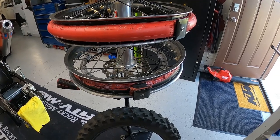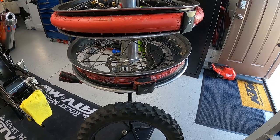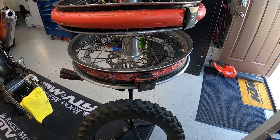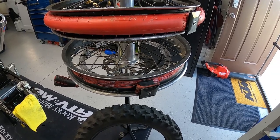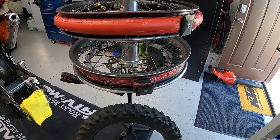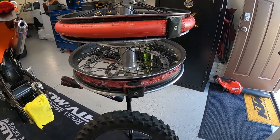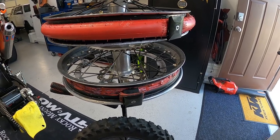Don't be afraid to try tubeless — I think it's great. I love being able to run lower pressures, although on this ride because of the gear — pannier bags and pretty heavy packs — I didn't run as low of pressures as I normally do on trail rides. I think I ran 10 psi in the back and 13 in the front the whole time and didn't have any problems. So don't be afraid to try tubeless. I hope this helps somebody have a little more confidence riding tubeless. Like and subscribe — thanks for watching guys.